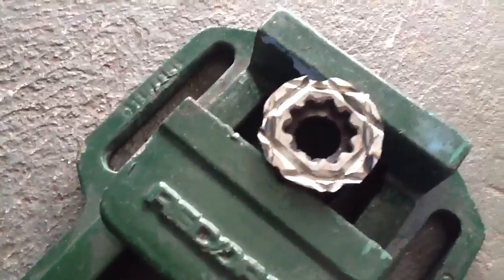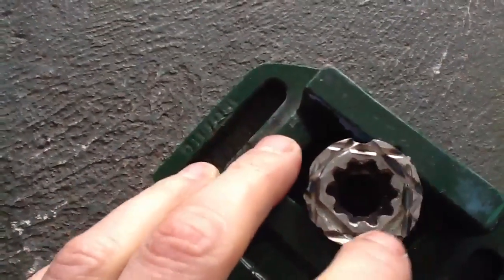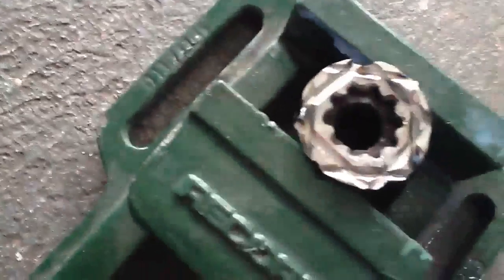Okay, so what I did was, took my Freehub, took my grinder, you should be able to see that. Okay, so I've put V-grooves in so I can get a really good surface area of weld all the way around here. Okay, the central bit probably still rotates if I try it hard enough.